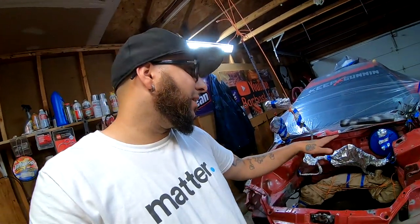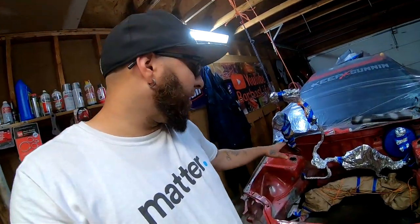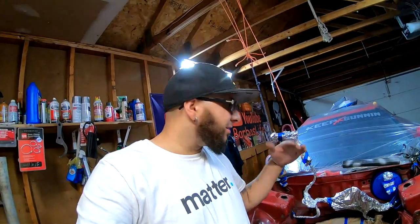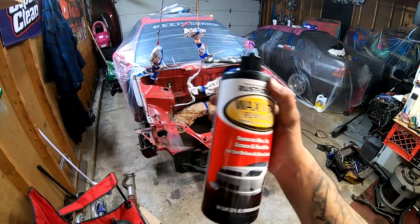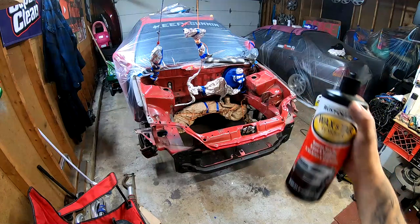I'm gonna start with a 400 because of the fact that this body is not bad at all. We don't need anything too rough. So we're gonna start with the 400 and work our way up to a 600. And then I'll decide if we go up to the 800 or what we do right there, because we are gonna lay primer and that's what we're prepping this for. Before we start sanding, we're gonna go ahead and use some wax and tar remover and clean the whole surface really quick.